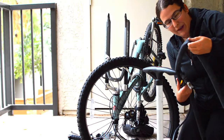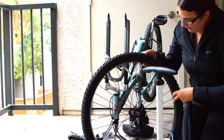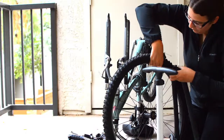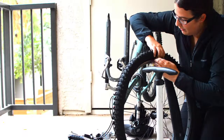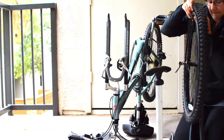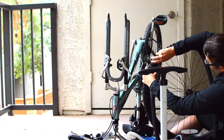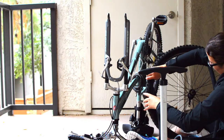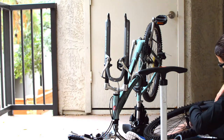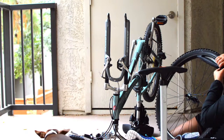I like it where it's bendable but still really flat — this is good. I always like to put the valve in first, so we find where the valve goes and angle it in. Then pull the valve really tight and gently push the inner tube in the rest of the way. Don't worry if it's slightly bunched — it'll slowly un-bunch as you fill it up.